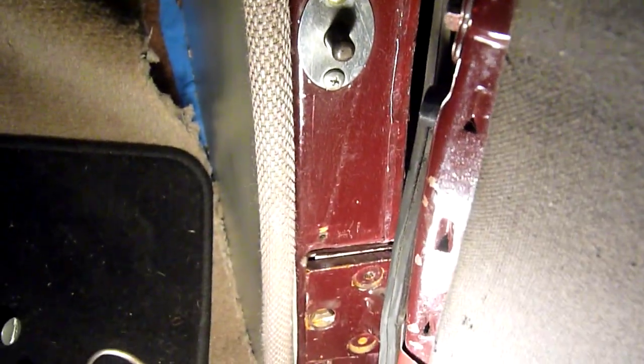I've loosened this wing — that's adjustable — and it's low here also, flares out. That's a different problem. So what I'm going to do first, since it's tight here not much to play with, down here at the bottom of the door — see there's already two shims in there, which is a bit of a concern because it needs more, and there's no shims up here, actually maybe one thin one.